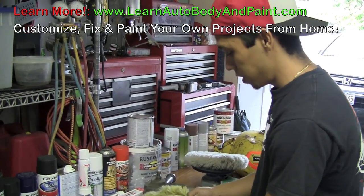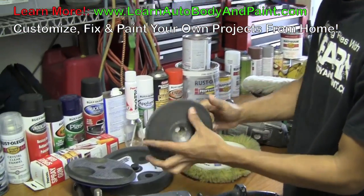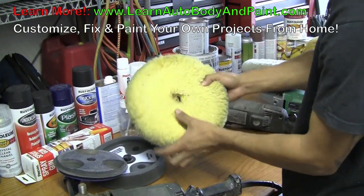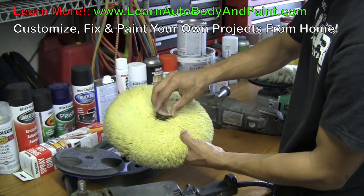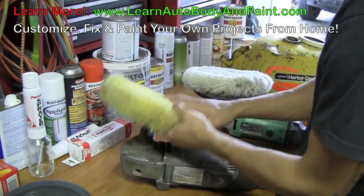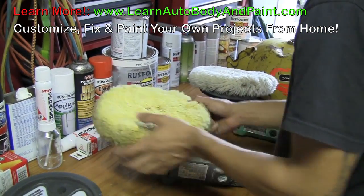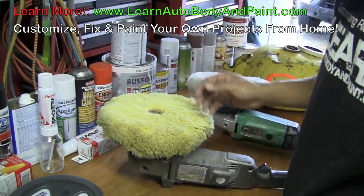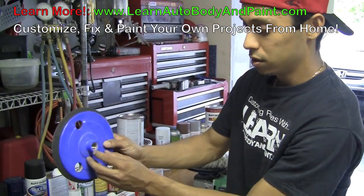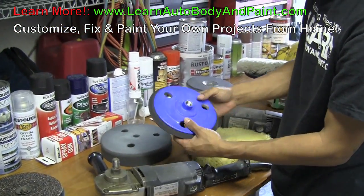This is another type of pad where it's not a Velcro pad. You just use this plate as a backing on your buffer. You put it in back of any buffer you want, then tighten it with this little bolt that goes through and onto the hub. That's basically all you do — it just tightens up. To take it off you have to take the whole thing apart, but with the Velcro you just put it on, leave it on all the time, and just change between pads. It's very easy to use and I do recommend it.